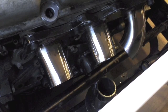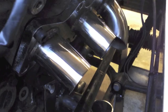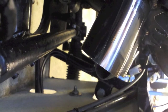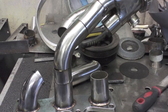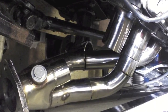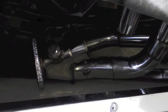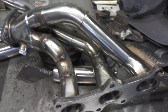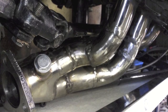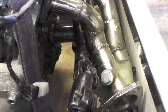The driver's side manifold was always going to be harder because of the steering column being in the way. I started by cutting off the tubes almost at the flange with just an inch or two and one bend left. Then tried to work out how to route it — it's pretty tight on that side with the brake master cylinder etc. So I started building it up, again a bit of a jigsaw puzzle with a few gaps which were difficult to weld. Getting it together with the collector clearing the steering column and trying to clear the brake master cylinder as well, and quite close to the chassis on the side. Started tacking it together — blew a few holes in this one because the tube is pretty thin — and eventually got it welded up. Not the prettiest of things but it seems to work. It's pretty close to the column, the side of the car, and the master cylinder, but hopefully it's okay.